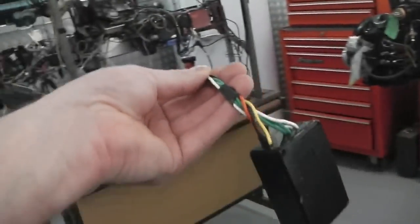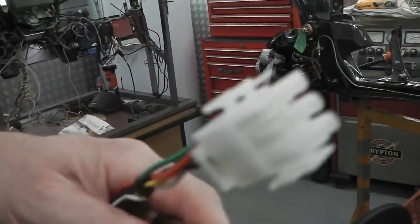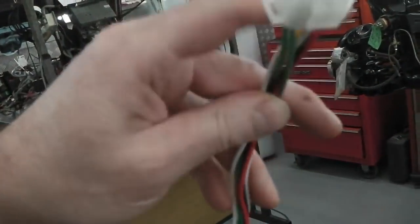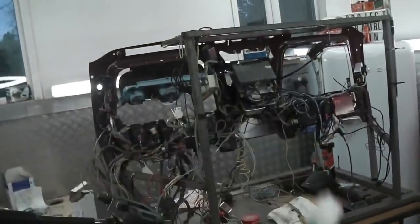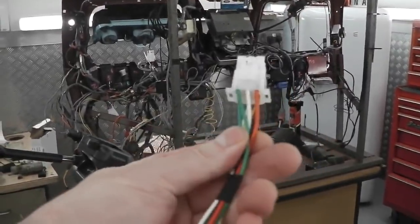Molex on the end of it. Look at that. That can go into there. Look, and it can be taken out. And if I find it's no good, if I find something doesn't work, all you do is copy that Molex connector wiring harness and build whatever you want, as long as it does the same wire pins as that. So you could adapt this if you wanted. You could build a clone of this. I could build two of these, a Mark II version, and as long as I wire the Molex the same, I can just plug in my Mark II version. So that's the great thing about doing it on these multi-plugs too. You can just alter your modules. The same applies to all the modules I've built on this. They all just unplug, as long as you've got your wiring pinouts, which I hope we have.